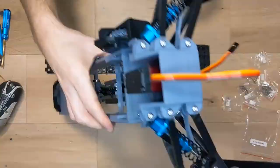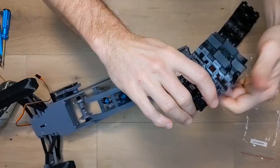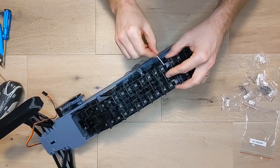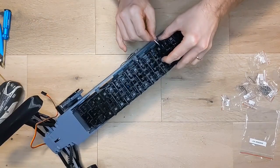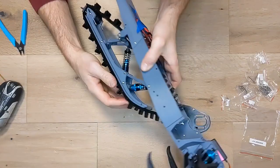Once complete, you can install the track by flipping the sled over and threading the track over the sprockets and around the rear rollers. The track is directional — when installed properly, the paddles on the track pieces on the bottom of the skid should be oriented so they are angled slightly towards the front of the sled. Use a remaining pin and a little extra force to connect the track together. Test to make sure it rotates freely, and then you can tension the track a bit by tightening the tensioning screws at the rear of the skid which push the rear rollers into place.